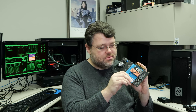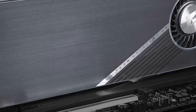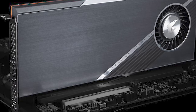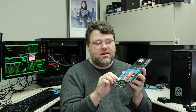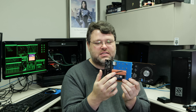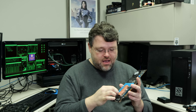If you picked up a Gigabyte motherboard or another motherboard like that, you may have gotten a carrier like this. This is what it looks like without a shroud — it's just got four slots here. Your M.2s can go there, and even though they don't necessarily screw down, when you put the heat sink on it you'll be a bit better off — it will hold them down. Or you can 3D print a bracket or extension. Again, four terabytes on a carrier. But this is designed for really high heat generation PCI Express 4 devices. This is also a PCI Express 4 carrier card with redrivers on the back, but these Kioxia drives are a PCI Express 3 interface — because, obviously, five watts.